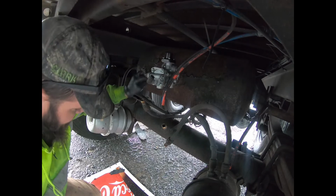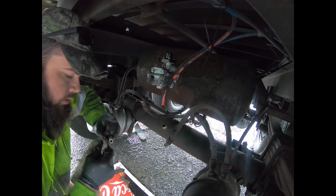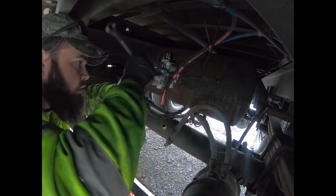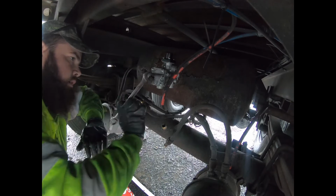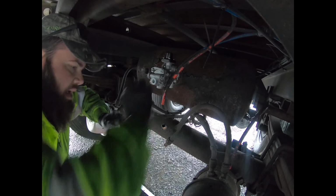Tight. One of our tank is falling off. Pull this one out. In little pipe thread sealer. And these two need to face straight up in this application for these lines. And pipe doesn't have to be insanely tight. The biggest thing is you need to be aligned. These are non-swivels, or the swivel part's broken, one of the two. So your biggest thing is alignment and just being snug, and the pipe sealer will do the rest for you.